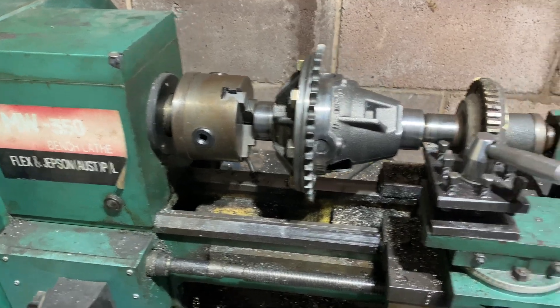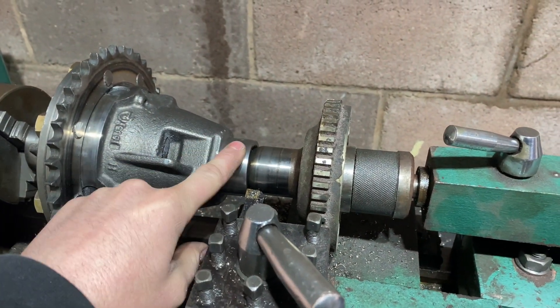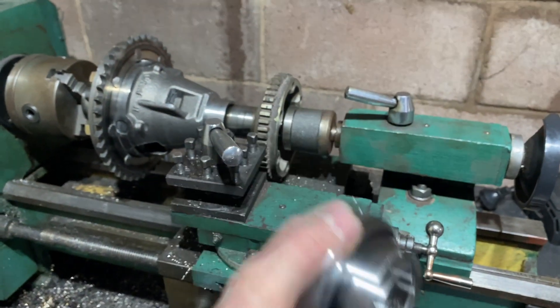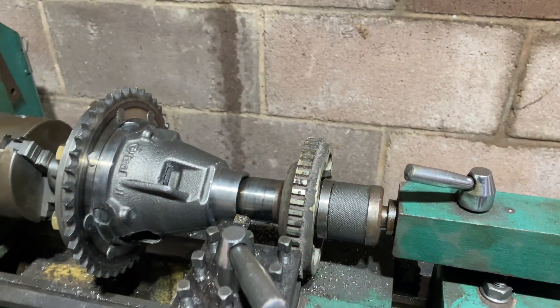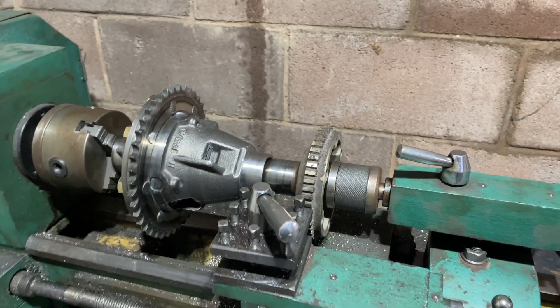What we're doing here is machining down the bearing surface — it's currently 45.5mm and our bearings are exactly 45mm inside, so we're just going to machine 0.5mm off this. I have tried emery tape but I'd be there for days. I've tightened this up tight enough that our spider gears don't move so we don't wear them out.